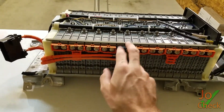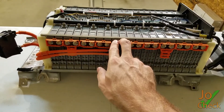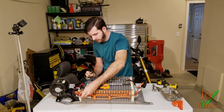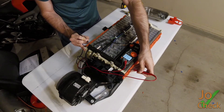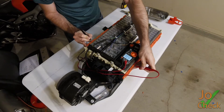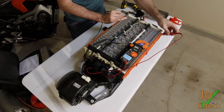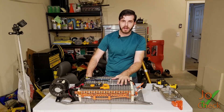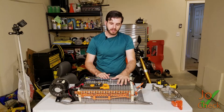You have the battery disconnect coming in here, which splits this pack on this side and this side — basically almost in half. First cell at 7.58 volts, so far it looks good. Second one also 7.58 volts. It looks like all these cells are good and they're all about 7.58 volts. Looking good for another battery pack that we can dismantle. That way we can check each one and discharge them two to three times — three times is better.